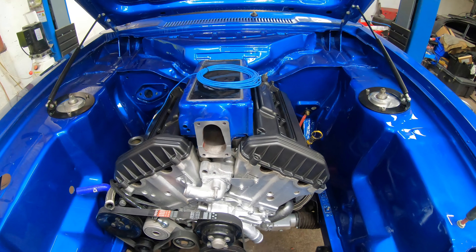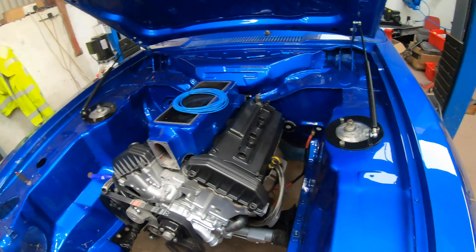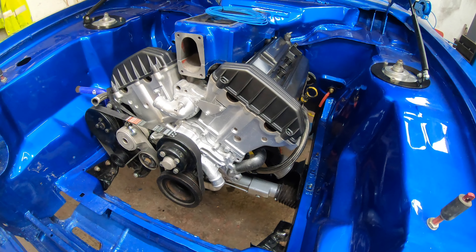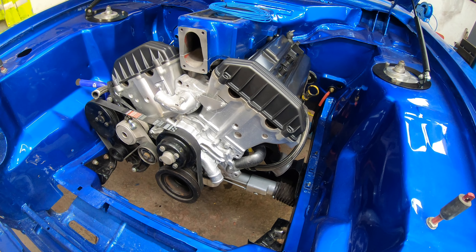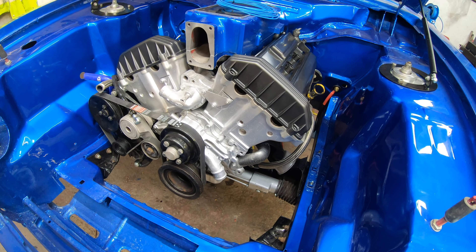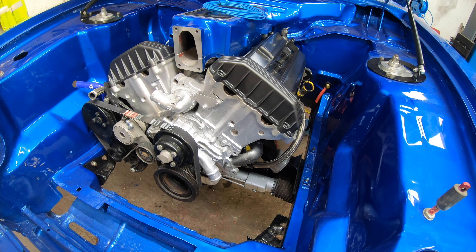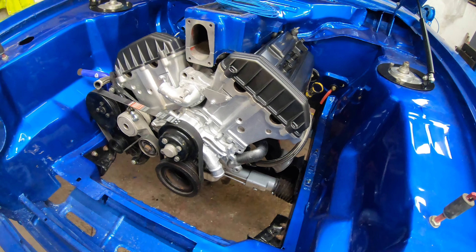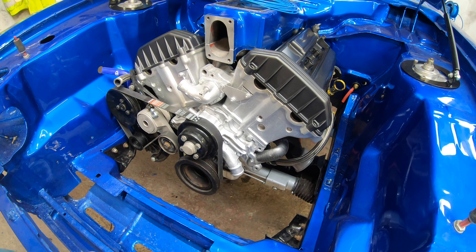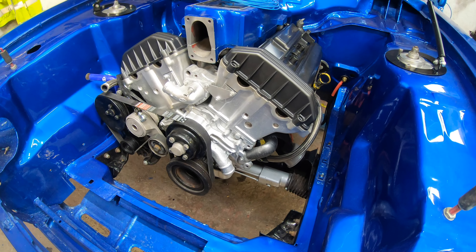Speaking of engine loom, I think I'm going to put it in next. I'm going to take this split grommet over here apart and get it fed through and located so that I can see where I have to cut it to put multi-plugs on. Because if you're taking the engine in and out, it's a lot handier just to unplug two plugs at the back of the engine and drop the whole lot — with wires and all on it — instead of having to take the plenum off and dislocate wrists and fingers trying to get stuff off the alternator and crankshaft pulley.